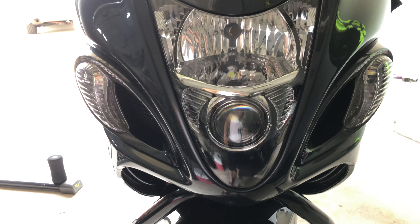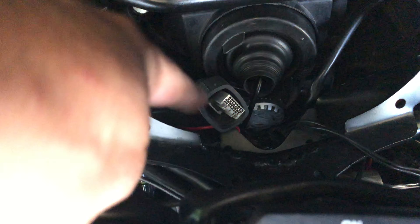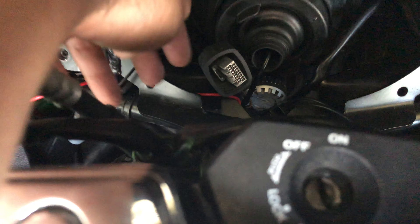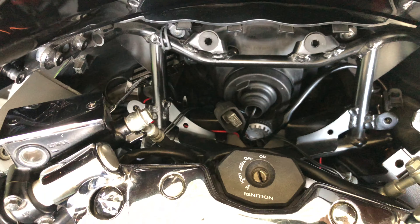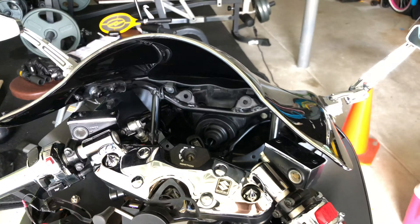Just make sure that if your headlight is malfunctioning and it's not going on, don't go too crazy taking the whole thing off. Just check the wire, the harness — the harness might be loose, which was what happened with the high beam. I took the whole bulb out, only to realize that the thing was totally disconnected and unplugged. I plugged it back together and that was it. But there's only one way to get there — you have to remove the dash. No getting around it, guys.